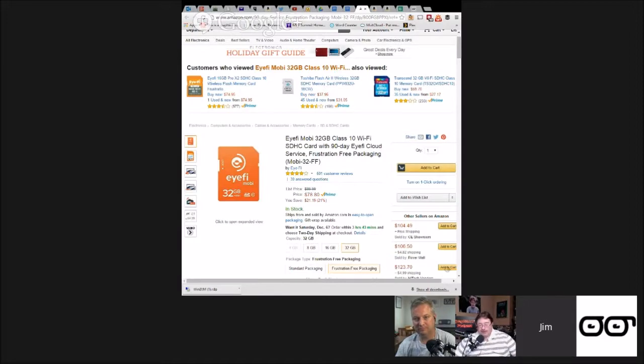Yeah, there's software that you use. Mine's a Spyder 3, so it's a little bit older than his. What mine does is it hangs on the monitor, and then it reads data coming from it. As it's doing the color calibration, it sends a bunch of different colors to the screen, a bunch of different shades of red and green and blue. As it's doing that, it's reading them, and then it makes an adjustment, creating a monitor calibration file. It also measures the brightness coming from the monitor, so you can adjust your contrast and your brightness.